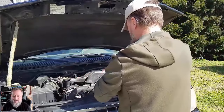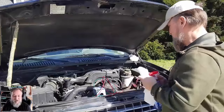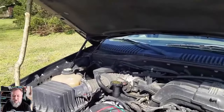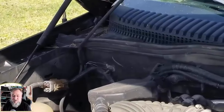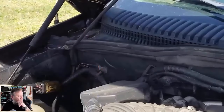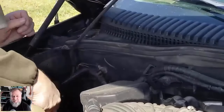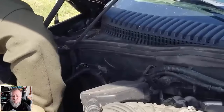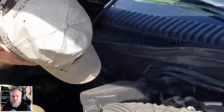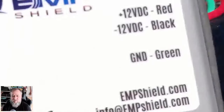And there's actually a diagram on it that I'll show you in a second. I'm going to use the adhesive, and I had to go get some Windex and a paper towel to clean off the spot. That bolt right in the center — that's the ground, and it's an awesome ground. I literally just had to unscrew it. Hopefully you'll be able to find those same things inside your cars and just find a spot to stick this thing. I sprayed a little bit of Windex, cleaned it off well, and made sure the device was going to fit and the adhesive would stick properly.